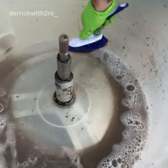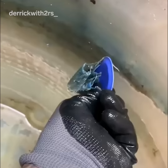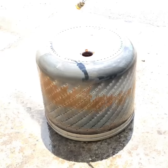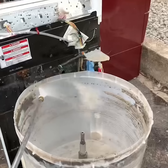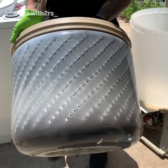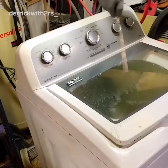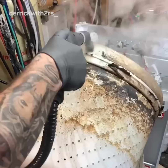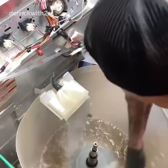My favorite cleaners are pine sol, bleach, and Lysol. Vinegar is more of what I recommend for people to use through a washing cycle. White distilled vinegar has acidic compounds that help kill some bacteria. When we pressure wash, we start on the outside — we can get much better into the balance ring. The pressure washer finds its way into all the crevices and does a much better job pushing out mold, mildew, detergent buildup, and fabric softener buildup all the way out through the holes. We rinse it out and we have pretty much a brand new basket. The steam cleaning comes after the pressure washing for a final clean — the water comes out at super high temperature, which effectively sanitizes any crevices or cracks that we can't clean with a pressure washer or bleach.